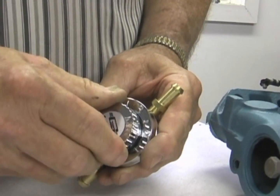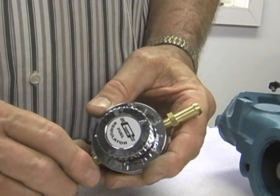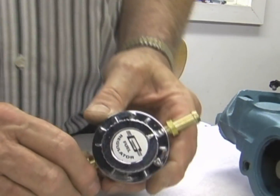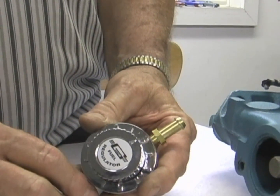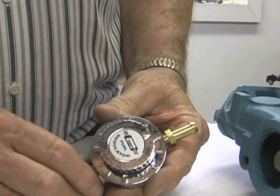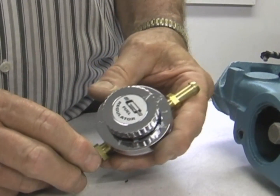You can try going higher, but there's really no need. My own car, a '65 GTO, is set at 3 pounds and runs 12.7 in the quarter. Basically you need to have 3 pounds when you're at full throttle at the top of second gear. You don't need a tremendous amount of pressure, you just need pressure all the time.